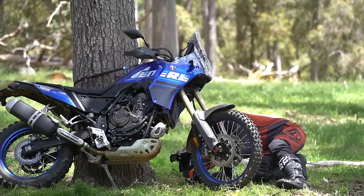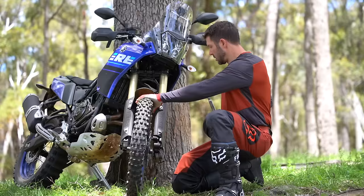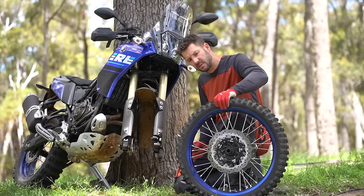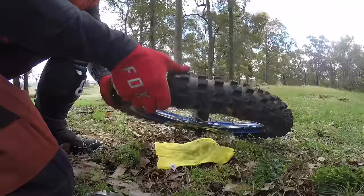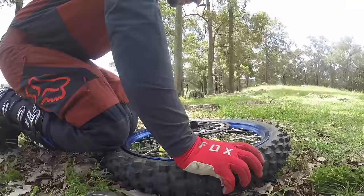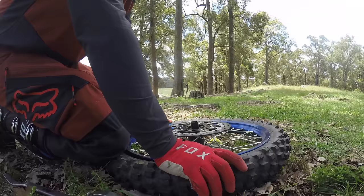The T7's got a pretty substantial side stand, so she's just going to sit pretty while you get the job done. Axle out. Wheel out. There we go — not magic, just logic. A freestanding motorcycle, front wheel out on the side stand. All you need is a tree or a fence post. One thing that's good is just to put a little cloth down, just to keep things out of the bearings and the spacers. It's good to do it in the dirt — that just pushes in, it doesn't bend anything. Soil gives.